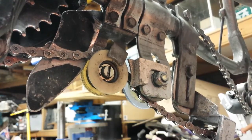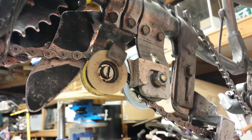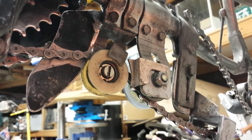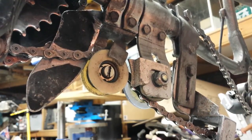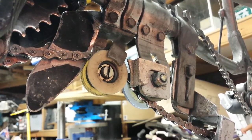I had endless problems with chainsuck that was coming from elliptical resonance. Part of that resonance was happening at part throttle, stemming back to the 10-tooth Chinese output shaft sprocket, which was causing tight and slack spots in the chain. At part throttle you'd have this increase and decrease in acceleration of the primary drive chain, which would then cause the final drive chain to chatter and move about, resulting in resonance, chainsuck, and all sorts of issues — derailleurs thrown into the rear wheel, front derailleurs ripped out. The whole works.